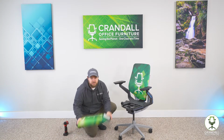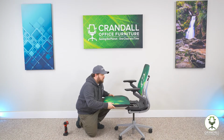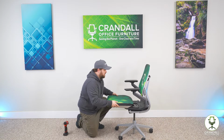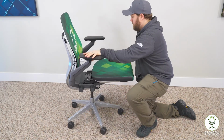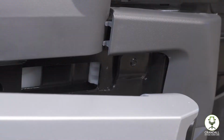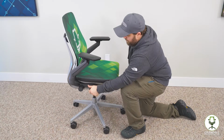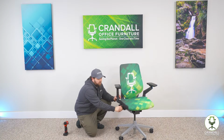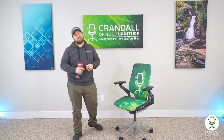We're going to take the seat and reinstall the seat. Again, quick and easy install. We do have a link in the description with another video for how to run through this process. But essentially all you're going to do is line up the rails here, slide it till it stops, and then start putting forward pressure on the seat and start rolling the seat slider backwards. And you can see it's going to start grabbing that. You're going to hear that click. That click is the seat locking into place. Make sure that it rolls back and forth and everything's working properly. And with that, your installation is complete.